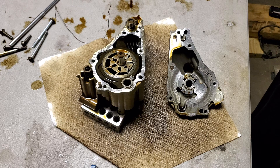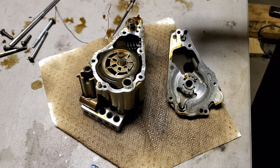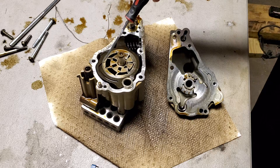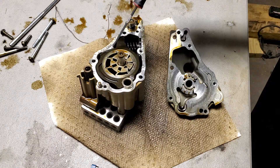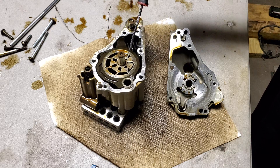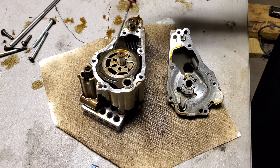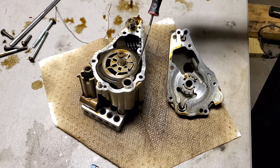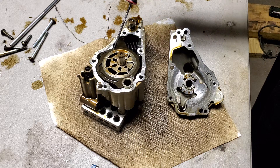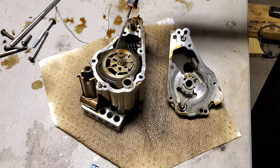First, explaining how this oil pump works. This oil pump pumps oil with a vane-type pump with an outside ring that's off-center from an inside ring. These volumes get smaller as they go around and pump the oil. But the outside ring is actually located inside a big plastic pivot, and this pivot when it pivots down will move the outside ring to be more concentric with the inside ring.